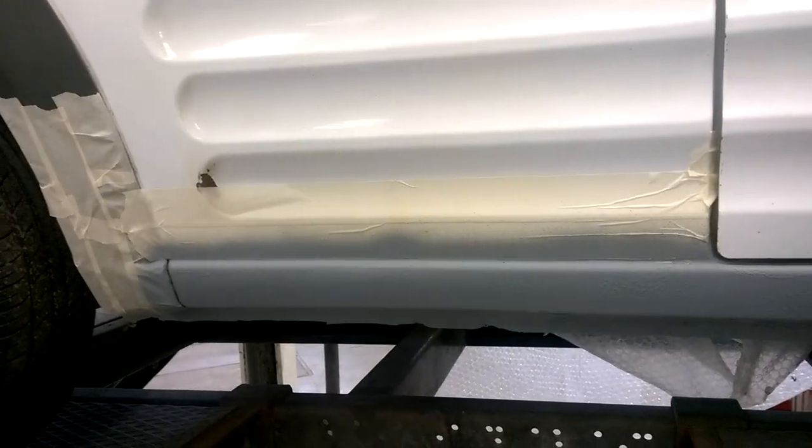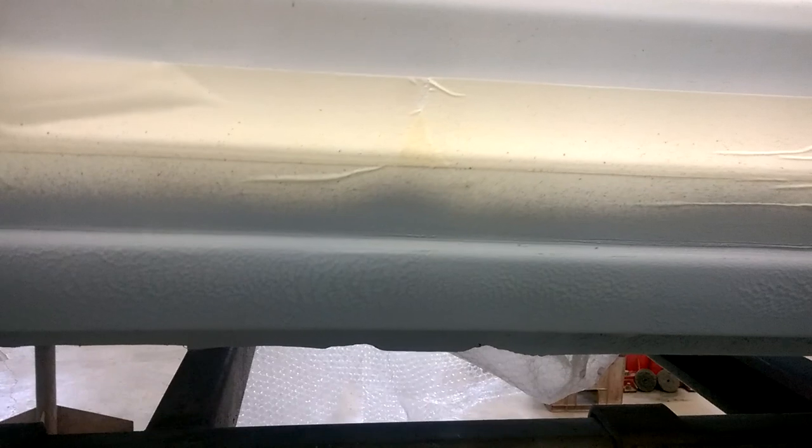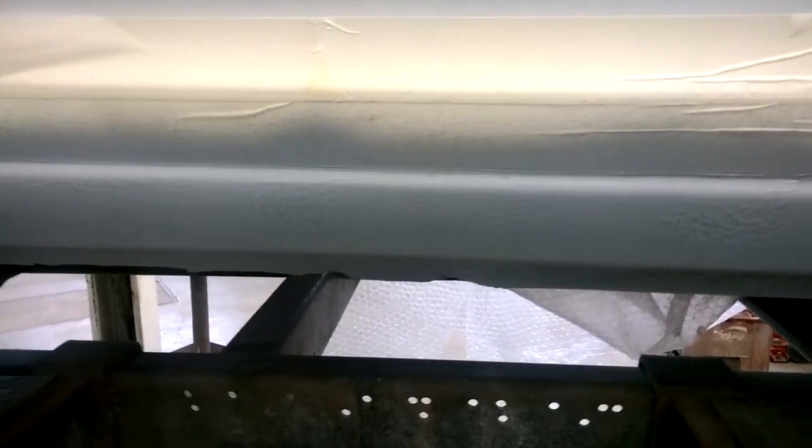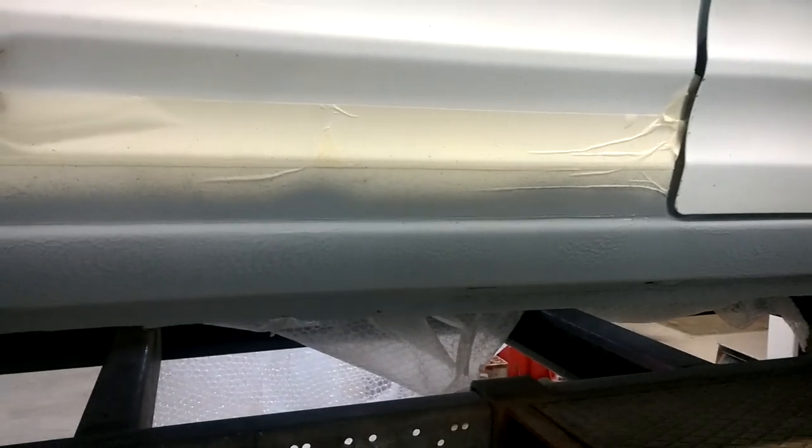There you can see the filling came out nice and the sealer came out nice. When the sealer is going on, panels need to be heated, so we have infrared lamps that we set up on stands and heat these areas before applying the sealer, because it needs to be a good temperature to make sure you have decent adhesion all around. The reason we're using the lamps here and not in the booth is because we don't need to run the oven just for this. We will be putting it in the spray booth and making sure it's up to the proper temperature for spraying and baking come painting time.